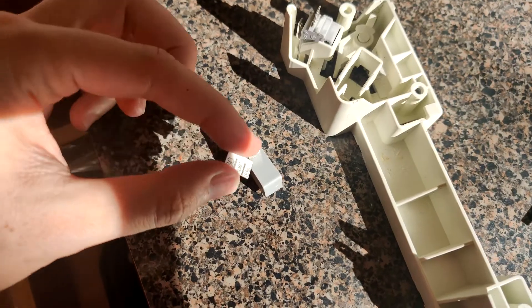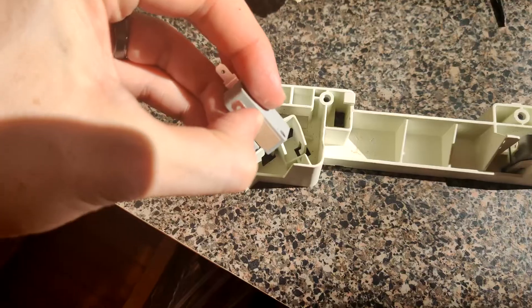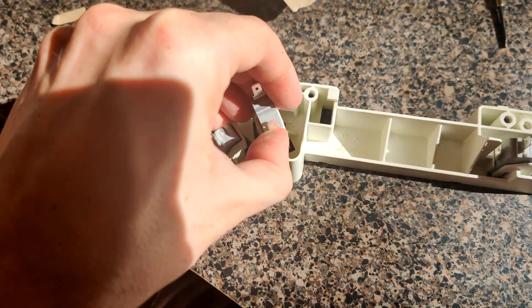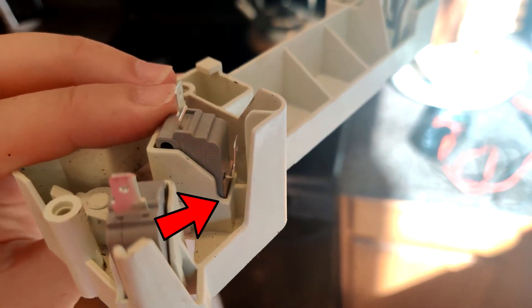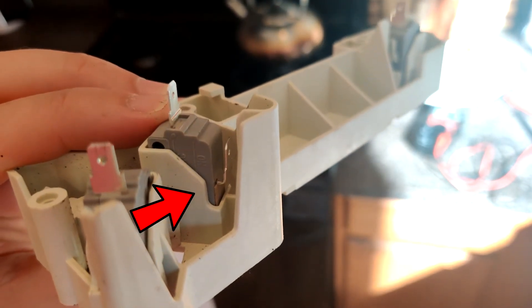What we need to do is put a thin shim on the backside of the switch to hold it forward, engaging with the door latch. I just cut out a piece of cardboard, like from a cereal box. When I installed the switch, I stuffed this cardboard in on the backside, which just pushes it forward enough to stay engaged with the door latch longer. Since I made this tiny, cheap adjustment, my microwave has worked fine for about three weeks now with no more issues.